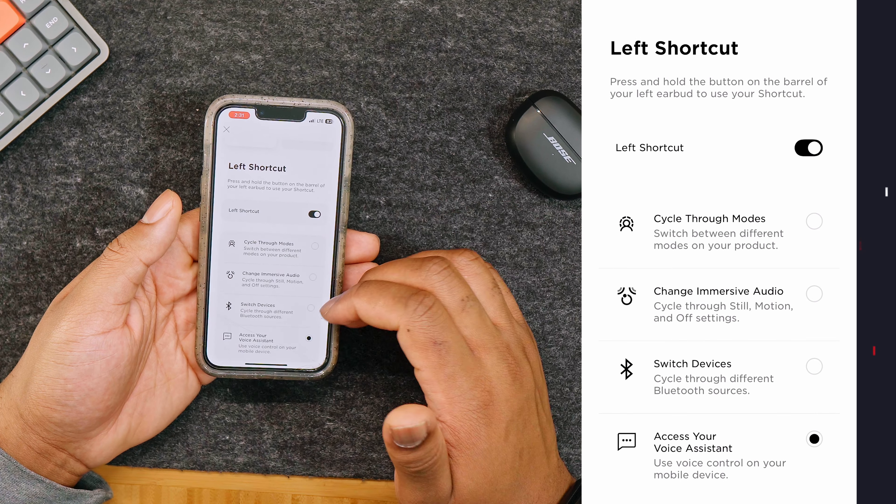Cleaning is easy — just use a cotton swab or a soft rag. Make sure to clean the ports so there isn't any gunk on them, so they will connect to the actual charging pins properly. Any soft dry cloth or a Q-tip will do. Don't use water, ammonia, alcohol, or anything like that, because they can corrode the metal charging points.